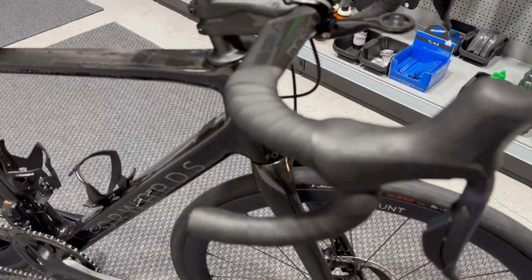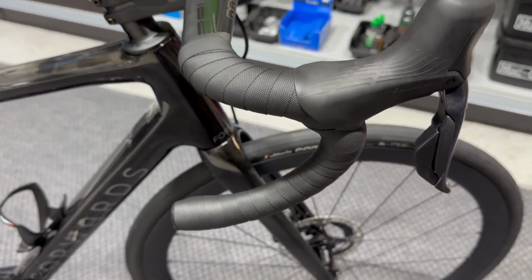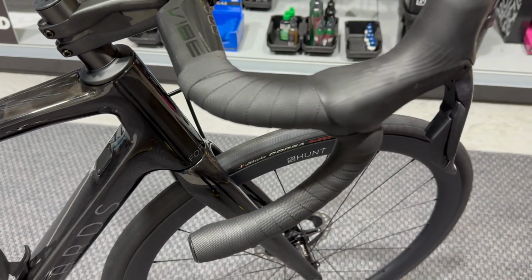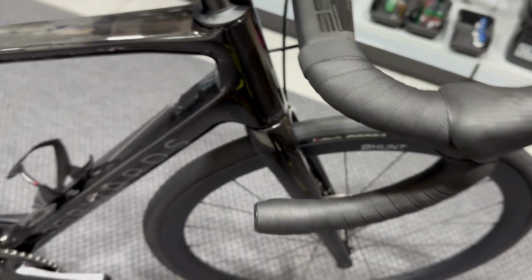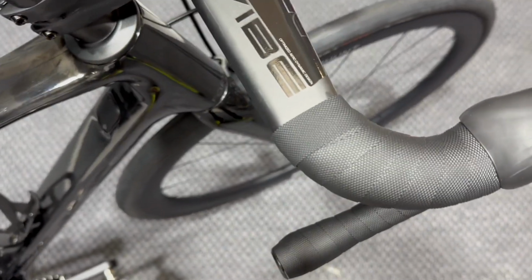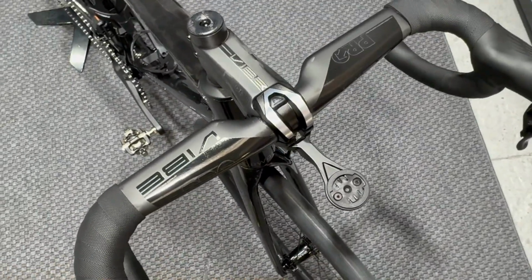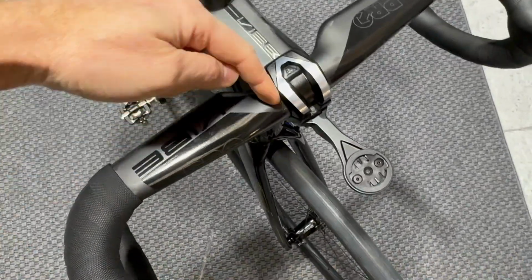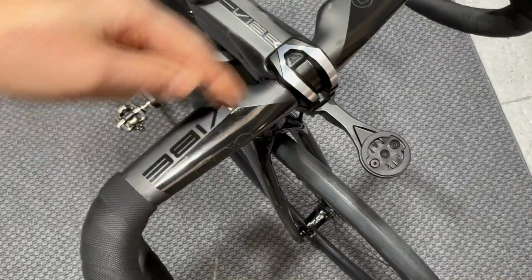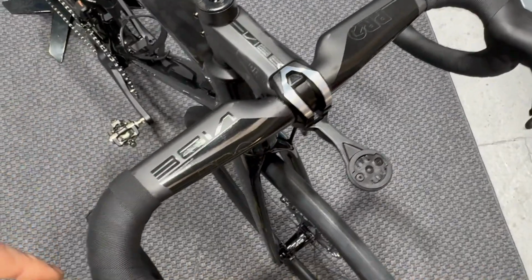So that's on there. Bar tape, it's got the BHT 14, which is the 2mm thick bar tape. Finish the bar tape in a figure of 8 round the hoods there, and then the end tape is a matching end tape, and then the gaps on this particular build, I've done that at 125mm, so that gap there is 125 both sides, so 125 there, 125 there.